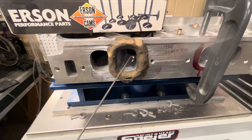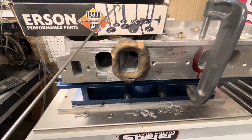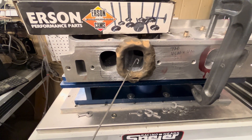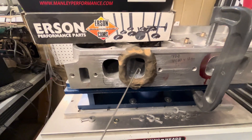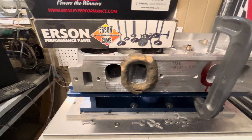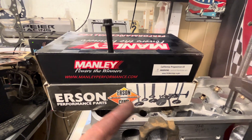So like this port, what's going to happen is it's going to start out here at the opening the slowest, and when I get back to the apex it's going to slow back down to about what the speed is at the opening, because you really try to make the floor wide so all the air can make the turn. So this is going to be kind of — I made me a little thing here.